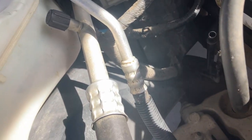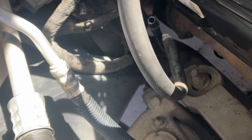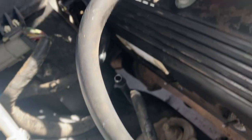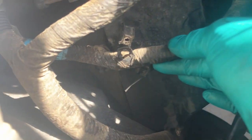One thing I forgot to say — and this was a lifesaver — is you remove this sensor from the housing. I'm not sure if you're going to be able to get the valve cover off without it. You just twist it kind of like a light bulb and it comes right out; then plug it back in. I also took off this bolt down here just to give this wiring loom a little more slack.